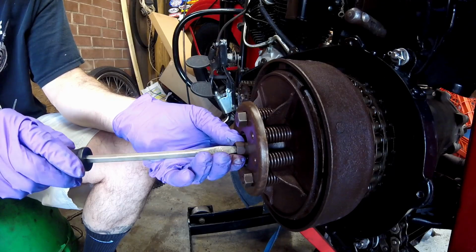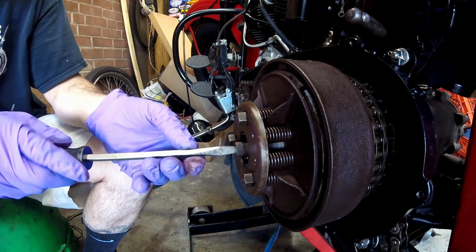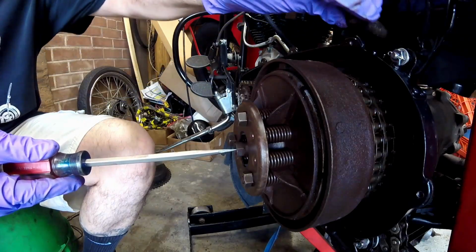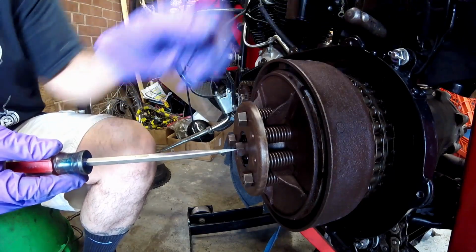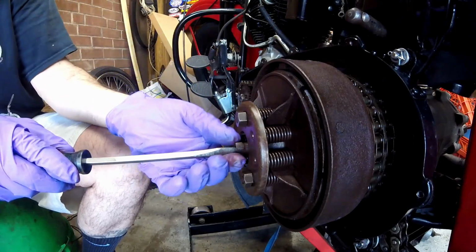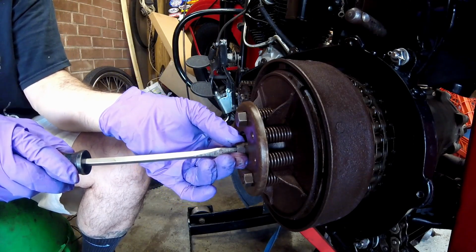Last thing you want to do is this clutch adjustment. So you back the jam nut off, you take it all the way down until it lightly stops, and then there's no play at this arm. I just back it off about a 1/4 turn. There's a little play here, and then I'll tighten this jam nut down.